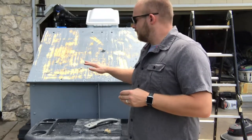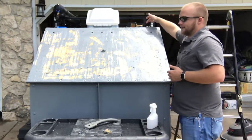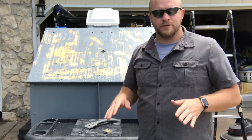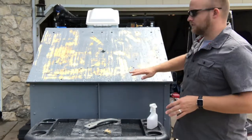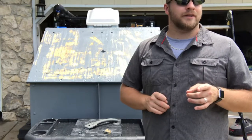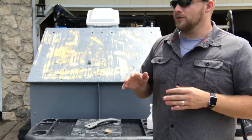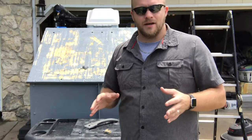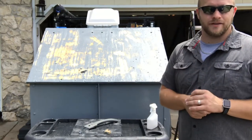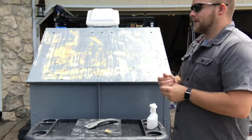I'm going to purchase two packages of fiberglass cloth, because they're 46 inches long, which should cover from down here to past my line. Then I'm going to sand it down, fiberglass everything, let it dry appropriately — hard, consistent — sand it again so the fiberglass cloth cannot be seen, and repaint it with at least three coats of paint. I also plan on putting a sandy, gritty texture on it, basically to remove the shine of the paint. The problem is this paint reflects a lot of light and shines right into the back of the Jeep in the mirrors when I'm driving down the road.